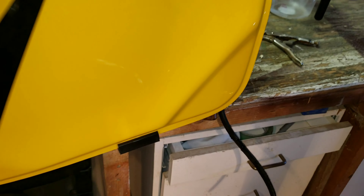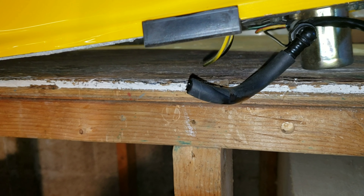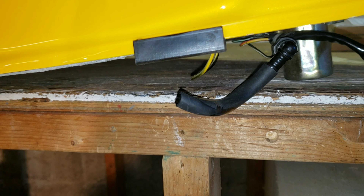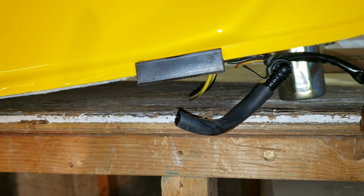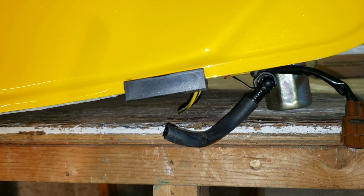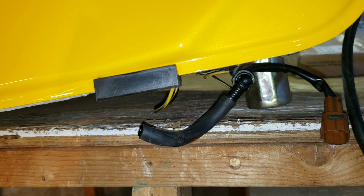The tank's off the bike. Just to show you here, there's where I had the little vice grips - I just took them off. I had a little tray down there, but there's only a few bits of gas that dripped out. So as I suspected, this system really only works when it's under pressure, and either that or this is totally plugged up. I'll find that out once I drain the gas. I'm going to very carefully tip this over on its back, see if I get any leakage, and if that's the case I won't keep it on its back. But I've got to get this piece off next, and then take it outside and drain all the gas out.